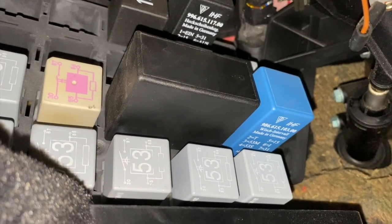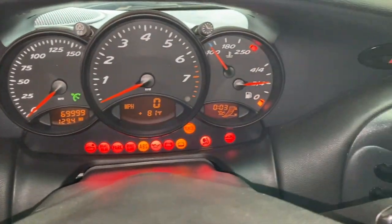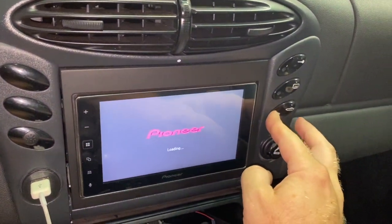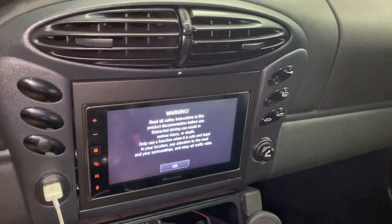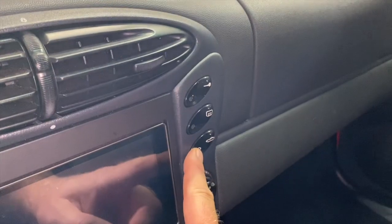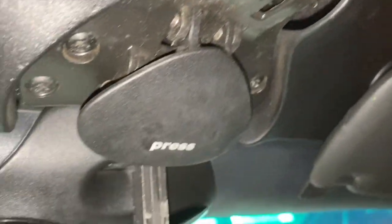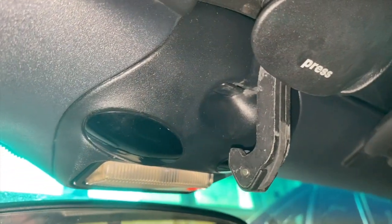All right, rustled that thing back in. All right, so let's give it another shot. My latch is still open, and it did not help. I also just want to note, when I am pressing this button, you do not hear any gears trying to turn or anything like that. So it makes me believe it's not a gear related issue or a motor for the top related issue.